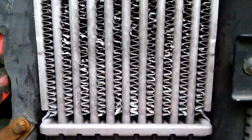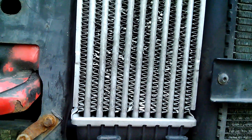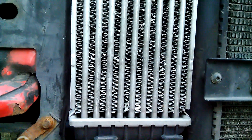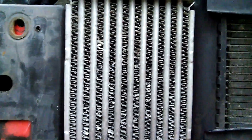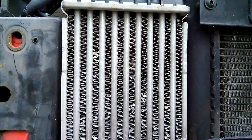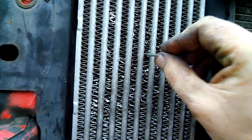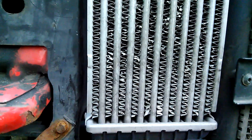It's basically aluminium, so it's prone to oxidize. If you purchase a new one or clean and degrease it like this, it would probably be helpful to spray it with some kind of aluminium coating spray paint to prevent this oxidation.